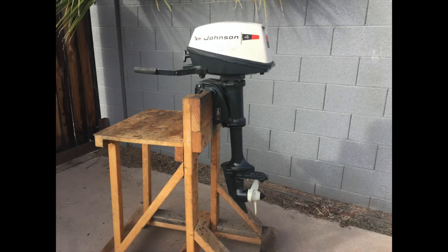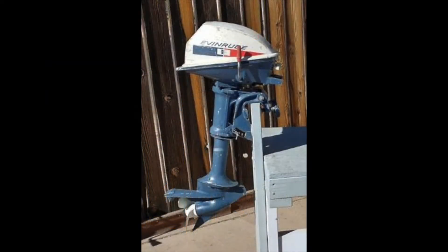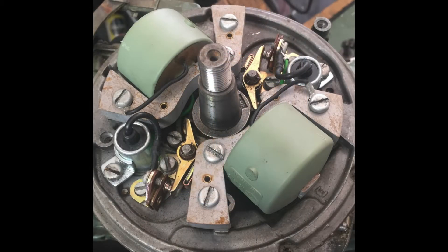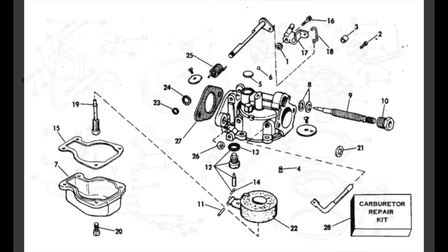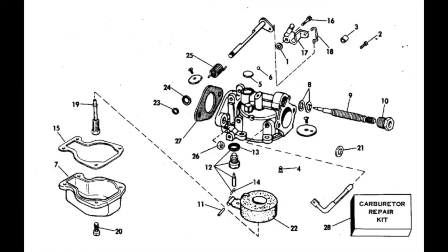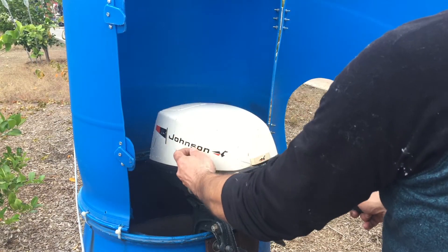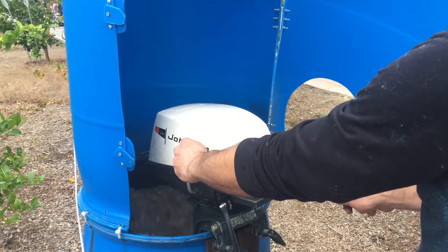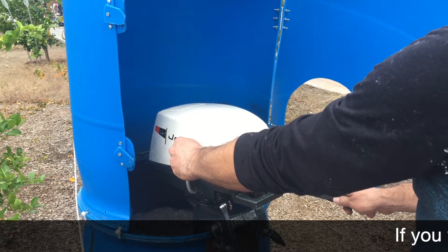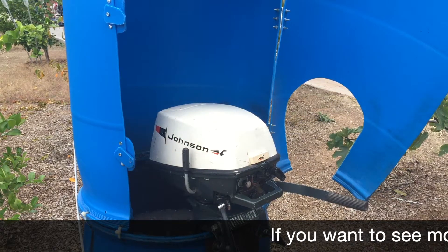The production of this series of 4 horsepower motors ran from 1969 to 2001, but there were many changes during this time. The motor started with a magneto system using points and condensers, then CDI ignition was introduced in 1977. The 1978 and newer models had a different fixed main jet carburetor. The most noticeable feature is that what you would normally think is a shifting lever on the left side is actually a throttle lever — the earlier 5 horsepower had this on the left side too.